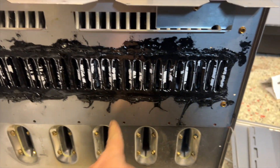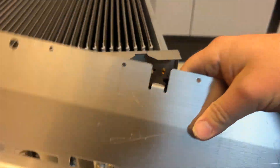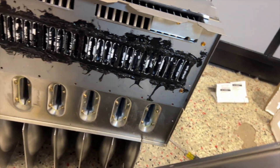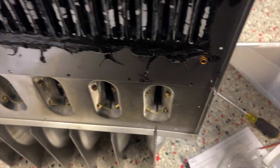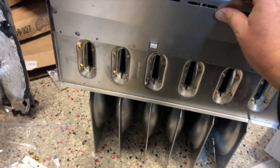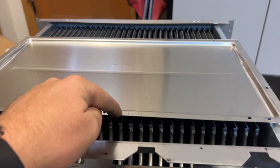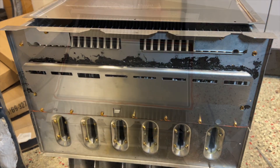We just want to make sure these holes line up. We're going to install the cold spot baffle — that's what these holes are here for — it goes right up against that. Then we install the coupling box. We'll get that screwed in, and then we need to put high temperature silicone all along the edge here before we screw that on to the back.